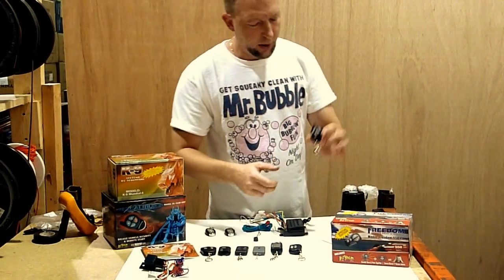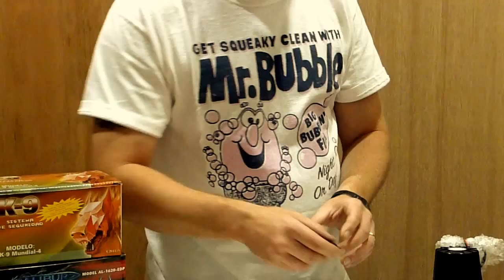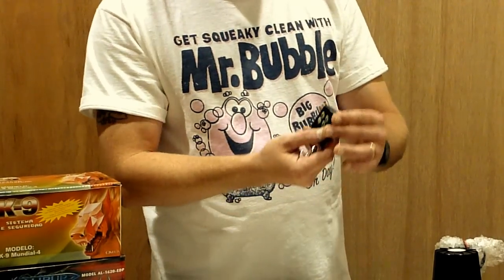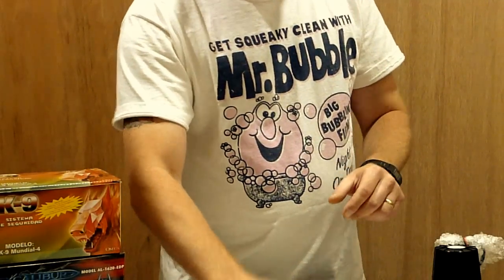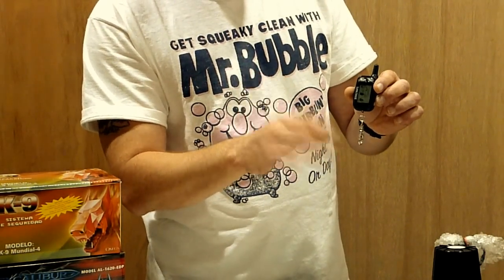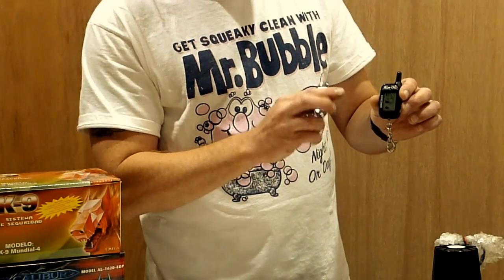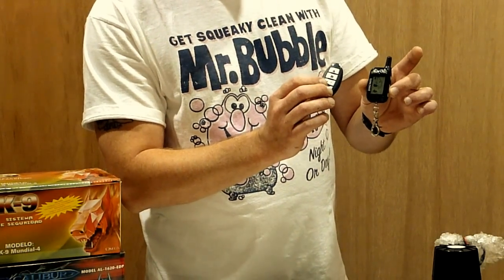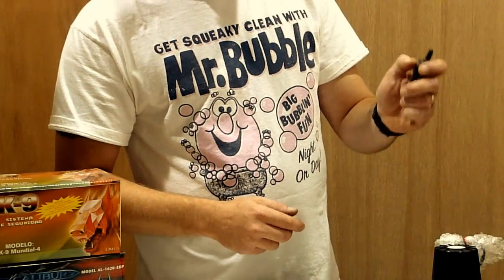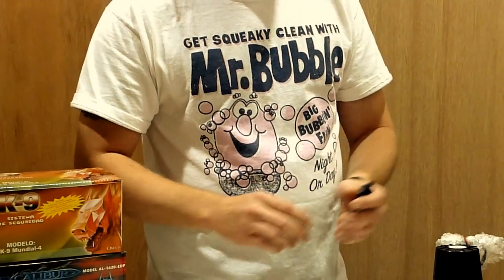But if your remotes look like one of these - like this here is a Mars-style remote control, they used to make these and stopped making them. This here is a Comfort Star type of remote control. This is a Crime Guard - you can find these in all their lines: Excalibur, Freedom, you name it. Two-way LCD remote, same thing. Just because the buttons look a little different, don't let it intimidate you - it doesn't mean anything. Same thing when you want to program this remote: cycle it, hit the valet switch, hold down your lock, do your other remote if you have another one, key off, you're out of there, done.